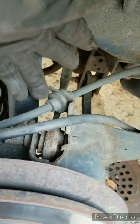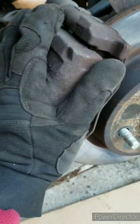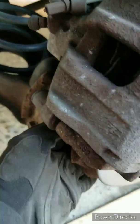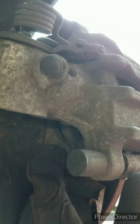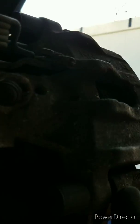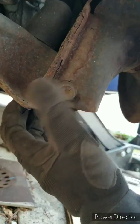That's attached to this back here. I will remove the brake pad — the caliper is just held on by two bolts. Right here, and on top is another one. I will probably have to move the brake pad out of the way first. And this bolt down here too. I believe they're all 17 millimeters each.